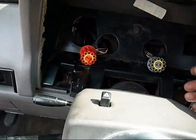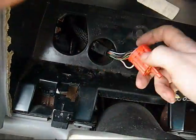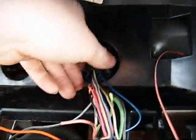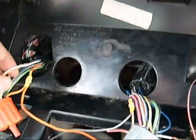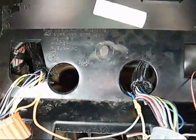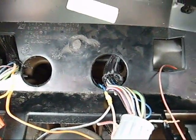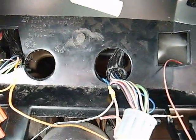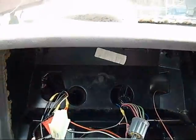I've pulled his dash out just the same, and I'm going to go ahead and tap into these wires. I've pulled back the insulation here and started doing a few wires. With digital dashes and a lot of aftermarket things - like gauge pods where you can change the LED color - they require a constant feed wire, meaning a wire coming from the battery that's always on regardless of the ignition switch.